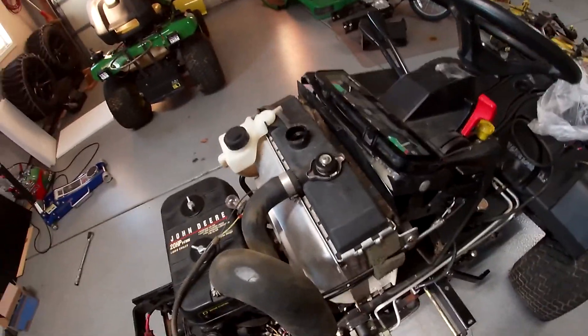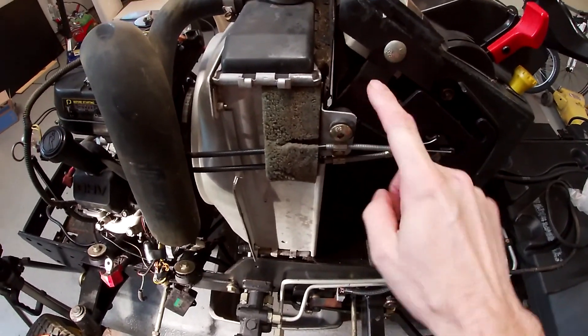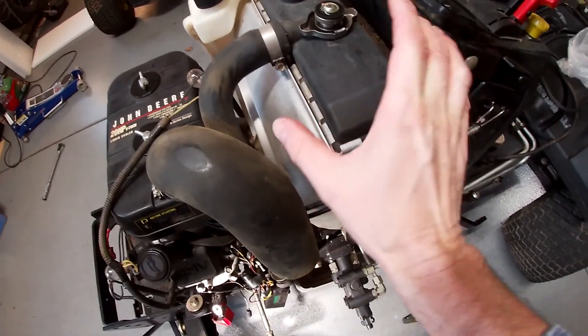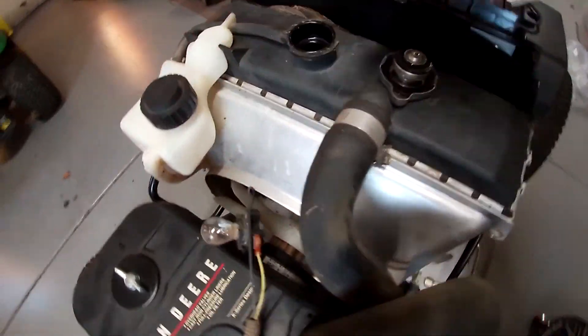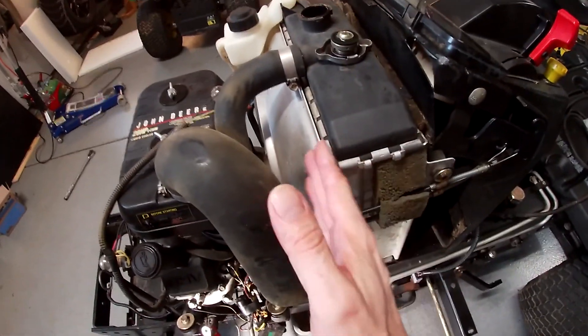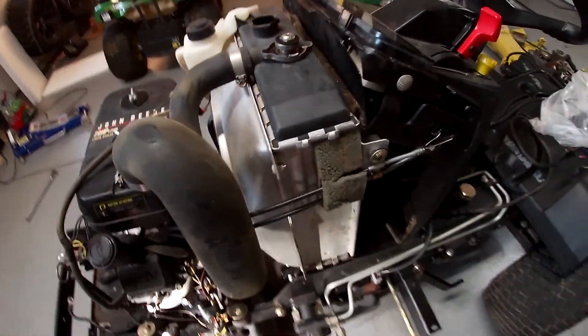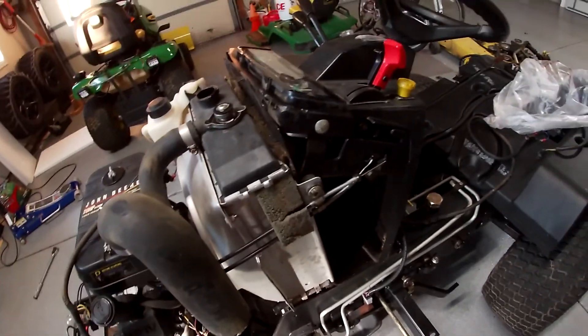So to get this out, I'll pull the hoses. There's a big bolt here that secures it to the dash, I guess. I think I'm going to have to take the fan shroud out because I don't know that I can lift this up and over and clear the fan. But if I unbolt the fan shroud and just push it to the side, I can pull the radiator out and then pull the fan shroud out. I've got cable connections I need to get off.